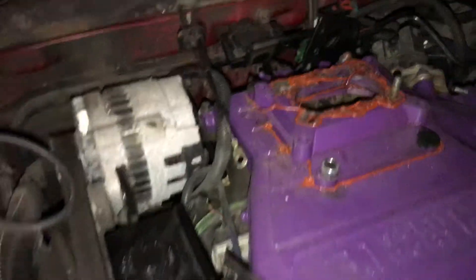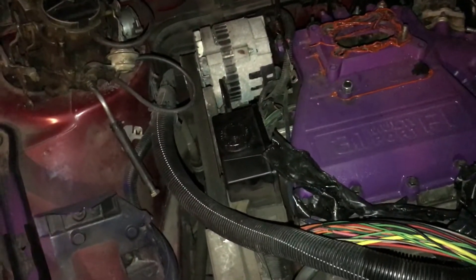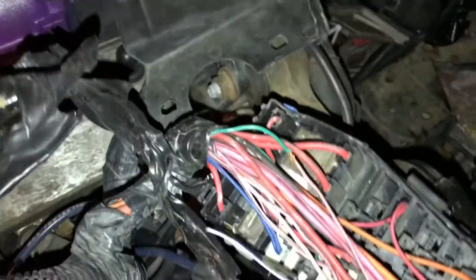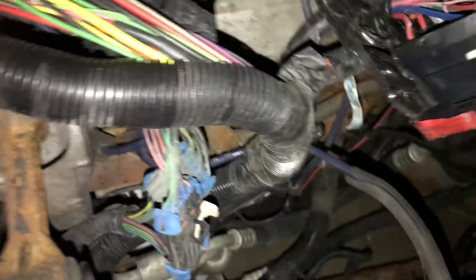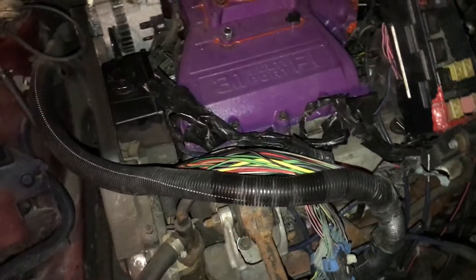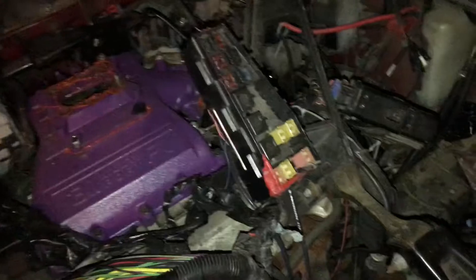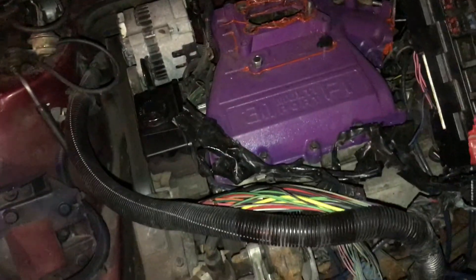The main reason I even did this is because when I first got this car, I couldn't figure out why it wouldn't run right. I ended up finding — underneath the fuse channel here, there's a green wire — I had to splice that wire back together because I wasn't getting pulse through the injectors. At first I thought I had a bad injector or two, so I replaced all the injectors, but that didn't end up being the problem. I was looking into it and just happened to glance upon this wire that was snipped or cut or torn. I spliced it back together, turned the key, and it started right back up.